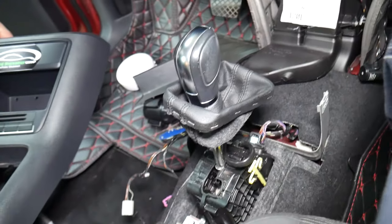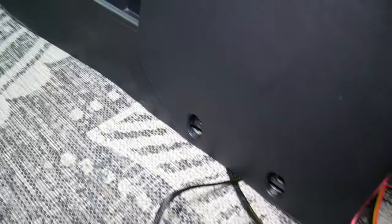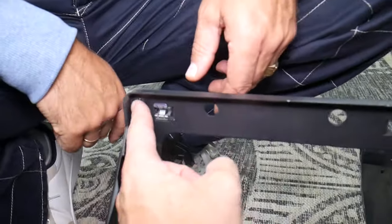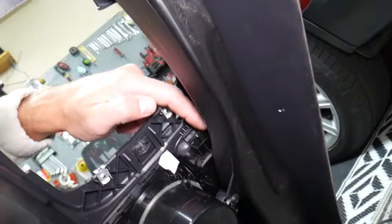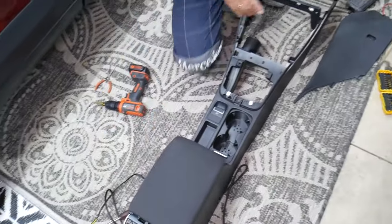Once you remove all that, you'll need to move the seat to access two hidden screws on the passenger side and two hidden screws on the driver side. Those are the two screws removed for the shifter, and underneath you have one screw on each side — two more hidden screws. Towards the front upper corners, you have two more screws, and on each side — passenger and driver — one screw in those holes that you'll need to remove as well. Finally, disconnect the switch for the parking brake and disconnect your wires. That's practically everything holding the center console in place.